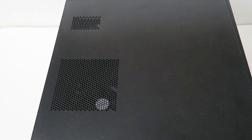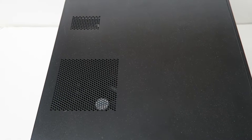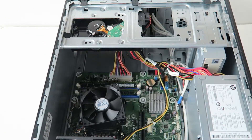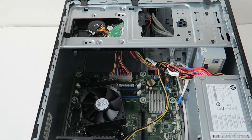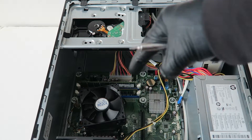You're going to remove the side cover panel — there's going to be a thumb screw right there and you slide it down like this. You will need a Torx T15 screwdriver, and we're going to remove the four screws from the heatsink fan.